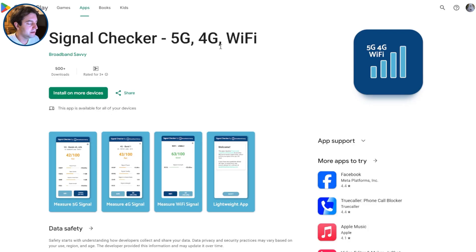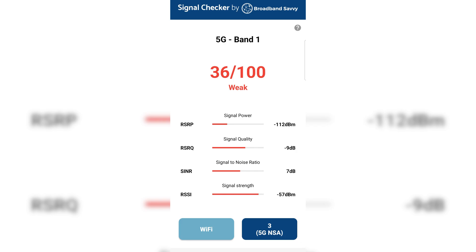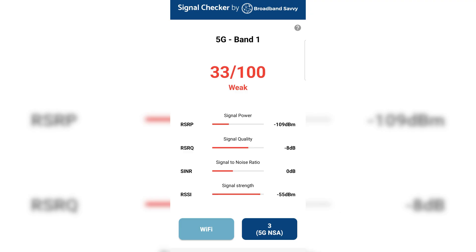Another thing you can do is, if you have an Android phone, put the SIM card you're using for 4G or 5G broadband into your phone, then download our signal checker app, which we've linked in the description. Once you install the app and accept permissions, tap the button on the bottom right to monitor your mobile signal, and then walk around with the app. Using the score shown, you can get an idea of some potential spots you might like to test the antenna. You shouldn't expect a perfect score with this app, because the antenna will pick up better signal than your phone can, so you can still get good results even if the app only shows a score of about 40 to 50. The app can also give you an idea of which tower you're connected to, which can be helpful in aiming the antenna.